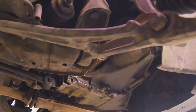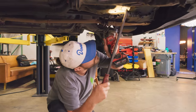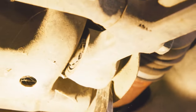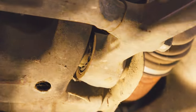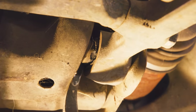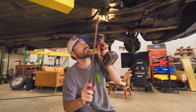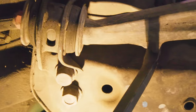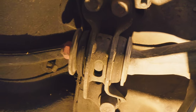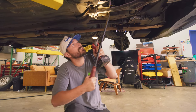At the front lower control arm, at the front bushing, it's pretty much entirely separated — it's ripped all the way around the middle. So it's probably pretty disconnected, which doesn't lead to great handling or good feel. This other bushing looks okay though — I don't see any tears and it actually looks relatively new. Give it a little pry... yeah, that's kind of what you want to see from a factory rubber bushing. It's not flopping around, no clunking, no noises, no tears. We're going to replace it anyway.